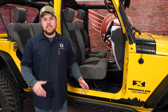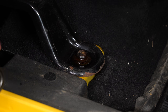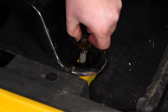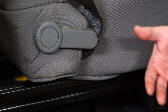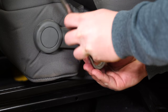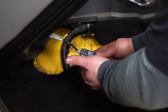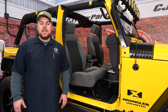The first step is to get our old seats out so we can remove the old upholstery. We're going to start with the four 18mm bolts and get both sides removed. We did use a little bit of penetrating lubricant just to loosen things up. On the 07-10 models, the seat belt is mounted to the seat frame using a T45 Torx bit — get that pulled off. On newer models it mounts to the pillar so you can skip this step. Before removing the seat, make sure you unclip the wiring harness — push it down and pull it right out.